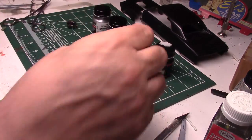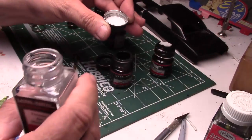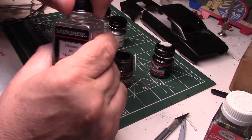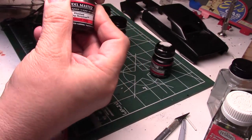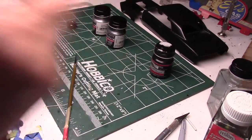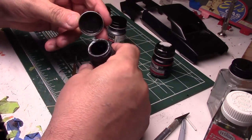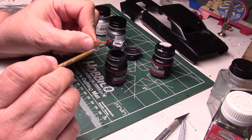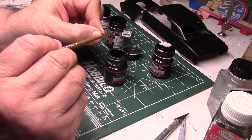Oh yeah, it is. I'm going to put a little bit thinner into this one. I just put a little bit into the cup, and I'm just going to drop it in there. It's not a science, but again, like I said, the thinner the better with these metalizers. They really work well, and they self-level and even out. Shake, shake, shake. Alrighty. Oh yeah, that's looking awesome. And again, like we did with the body, we're going to get it pretty wet and get it all on there.